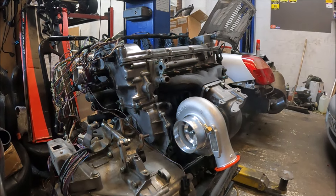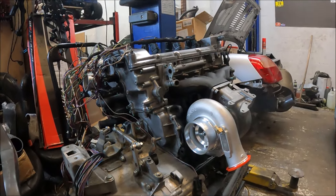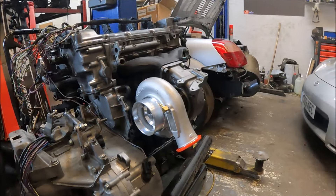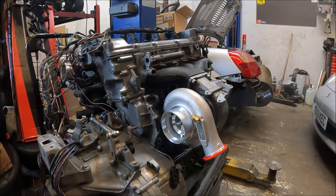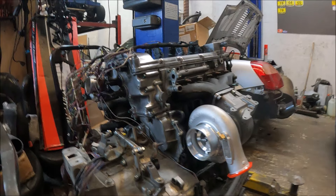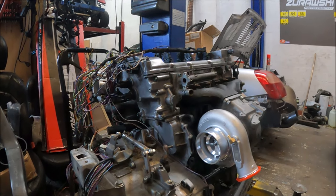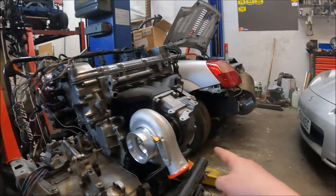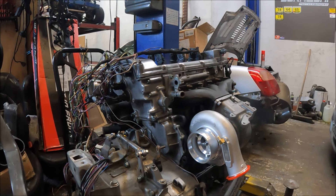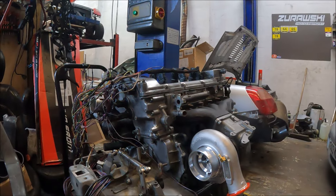Another effect of smaller turbine housings — you see it on OEM cars and on modified cars in dyno results. A factory turbo car at factory boost might make peak power at, say, 6,500 RPM. That same car, no changes, just more boost — say another 30 horsepower — but if you look at where peak power RPM is, it's often dropped by like a thousand RPM. That's because they've got a small turbine housing and the more boost, the lower the peak power tends to be, because the turbo housing is choking it a little bit. So a small turbo housing can pull peak power surprisingly low — that's actually a good sign that your turbine size is restricting it.